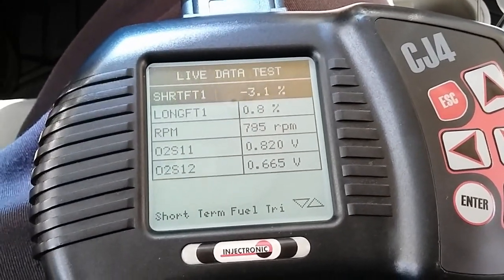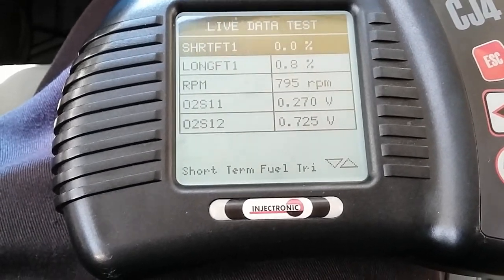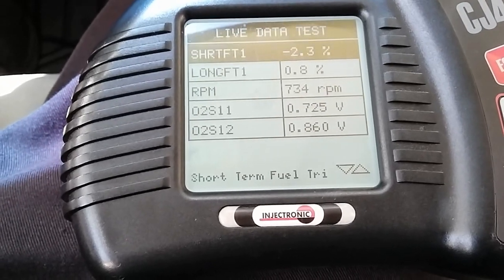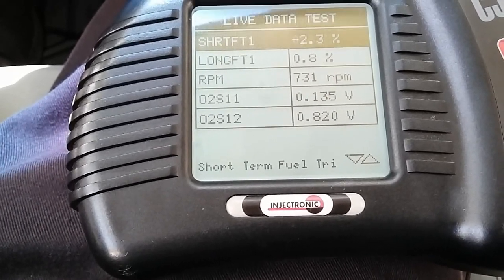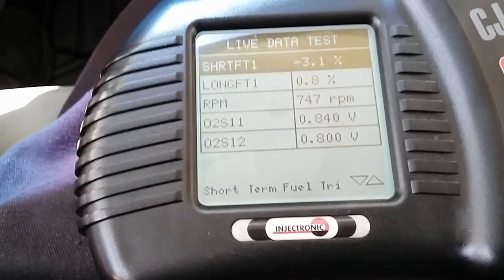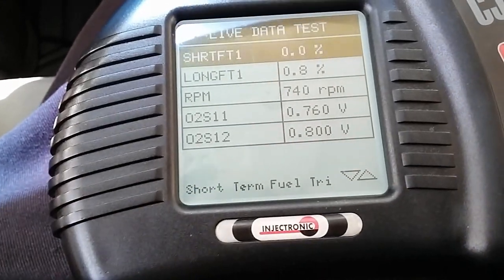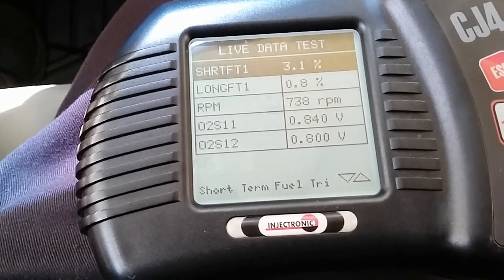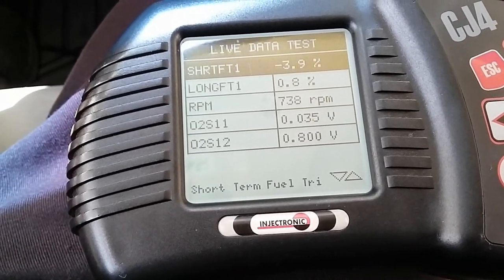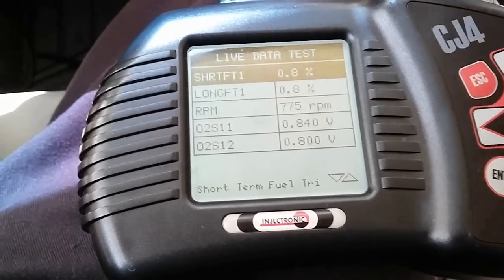The best way to notice if we actually fixed it is to perhaps drive the vehicle for a while, and then look at your long-term fuel trim once again. Or, if you have a capable scan tool, you could reset the memory and wipe the whole fuel trim cells and start pretty much from zero again. So I'm gonna do that.